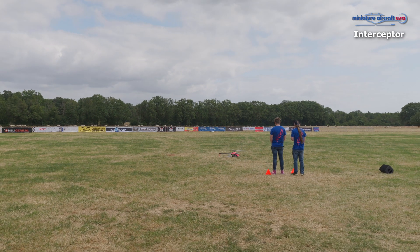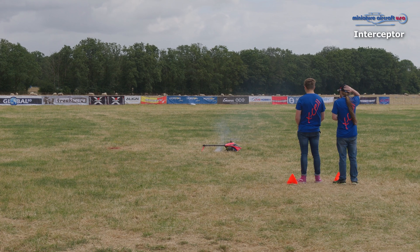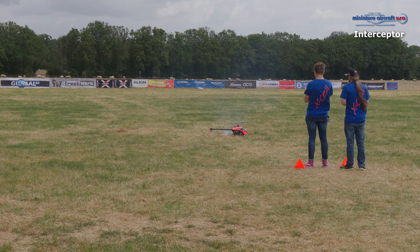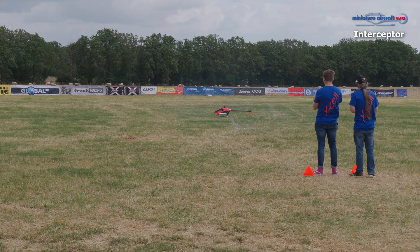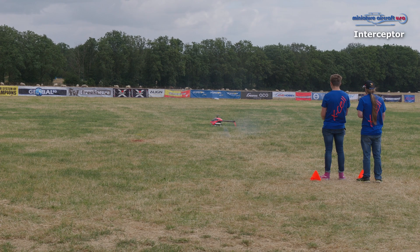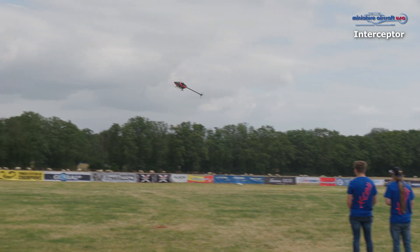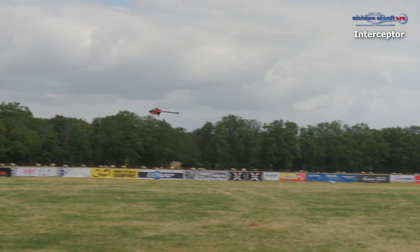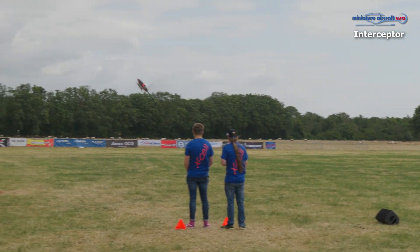Can you talk a little bit about it? Yes, this helicopter is designed especially for the OSGT-15 HZ, second generation. It's a 400cc tank, you can fly up to 30 minutes, and the fuel for the helicopter is standard pump gas, 95/10, with about 6% oil — so the costs for the fuel are really low.